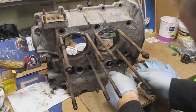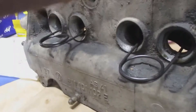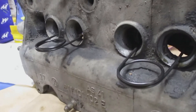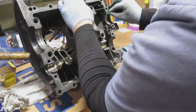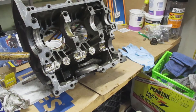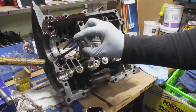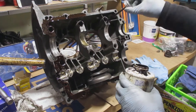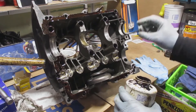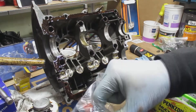These are pretty nifty things for the lifters — they're spring-action clips that hold the lifters in place when you put them into the case, so when you actually install the case half the lifters won't fall out. I've had problems where the lifters would always fall out, and fixing them was a fun thing. After cleaning up the engine, I'm applying Permatex aviation gasket sealer — it stays kind of moist until there's no air, so when the two case halves go together it seals up the case very well.